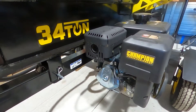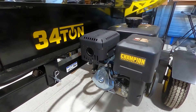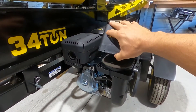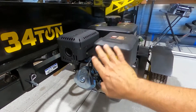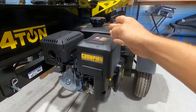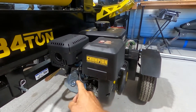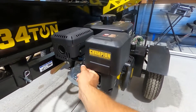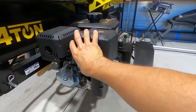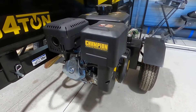The best place for this particular machine — and you'll have to think about this for any machine you do — is right here on this air filter cover. This does pivot up and it's got a little hinge on the back, but I can mount it somewhere here or here. I'm probably going to mount it on the top so I can just see it without having to lean down. I can route the wire down and wrap it around the spark plug boot, leaving enough room to unplug it when changing the spark plug and enough slack for when I lift the cover.